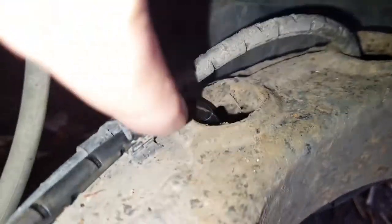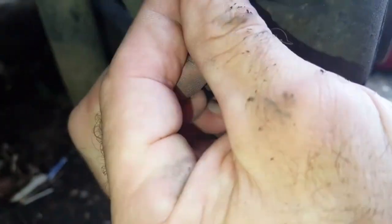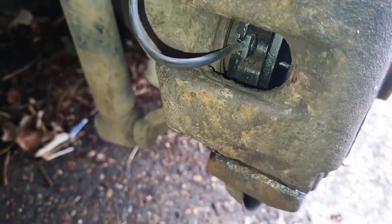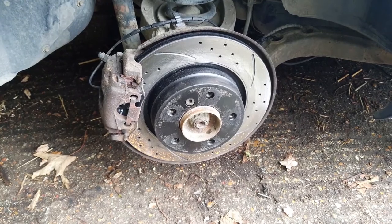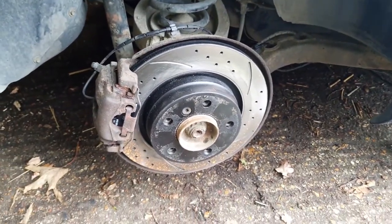Then you just route around, pulling these little clips down and feeding the cable into it. Come through there, just lift up these little clips and tuck the wire under as you go round. Then you come round to the side here and you just push-fit the metal piece — probably have to use a pair of pliers just to get that in there. There you go, just push-fits to the side, so that's now in place. That's how you fit your rear pad sensor — saves like 35 quid for 10 minutes.